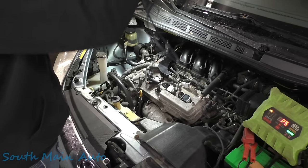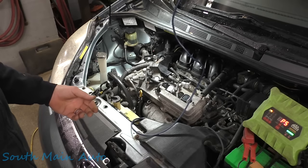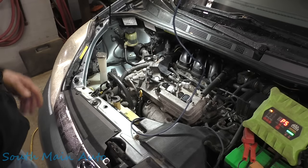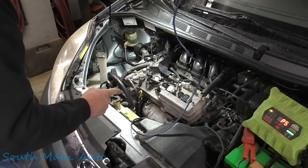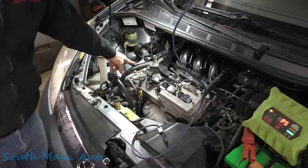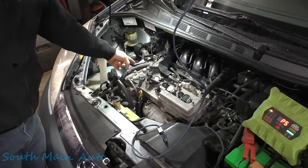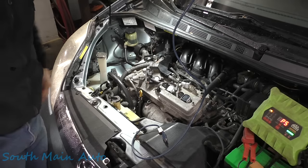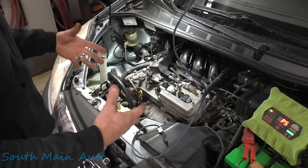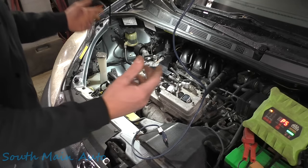So perhaps that's why he didn't have good success swapping the sensor - either there's a wiring problem, or it could have poor cam timing. I only started it and just kind of idled it inside, didn't drive it, so I don't know if there's cam timing issues there. I see it does have a new cam solenoid at least on this head. I've got the Pico out here - let's probe into the known good one and see what's coming out of that. If they both look good, we're going to have to grab the crank signal to see if everything is in sync. Toyota service data gives you a known good waveform to a certain degree.